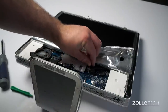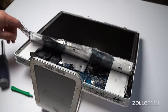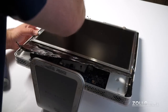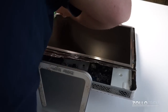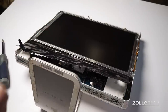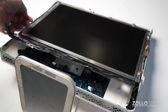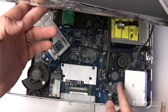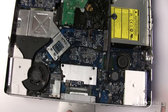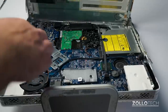Now we can remove this by simply pulling this tab and we disconnected the display. Now we need to remove the shielding along the edge so that we can unscrew the display and remove it from where it sits. Now that I have everything removed as far as the shielding goes, I can remove four Torx screws — one in each corner — that will allow me to lift the display up. I can actually flip this display up carefully. There is also another connection down here that you'll need to undo to remove the screen. Make sure you've done that, then flip the screen out of the way. You can remove the screen entirely or just lean it up against something. You can see the hard drive is here.